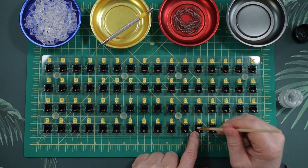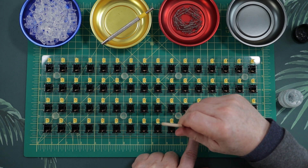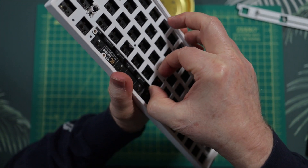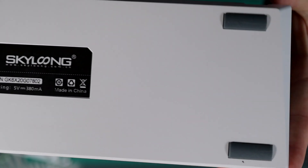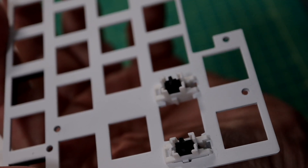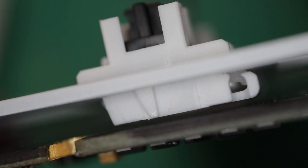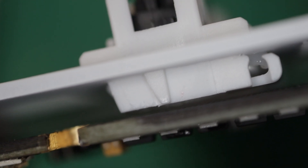Once the switches are properly lubed and filmed with Krytox 205G0 for the stems, Super Lube for the bottom of the springs, and switch films from TX keyboards installed, it's time to take this keyboard apart. You could just take out the black screws and remove the plate and PCB as one unit, but the plate fits very tight, and to avoid damaging anything, I removed the screws and took them out separately. Two things really surprised me about this keyboard, especially at this price level. First was the quality of the case and how tight the stabs were in stock form. The USB connector is on the left, as it should be, and the edges and molded surfaces were as close to perfect as you could expect. The stabilizers are very tight in the plate, so not only do you not need to band-aid mod here, it's too tight to be viable anyway. The stab bottoms are also just high enough off the PCB that they don't hit, so band-aiding that or using something like Levi's dampeners will have no effect, and clipping the stabs doesn't gain anything.